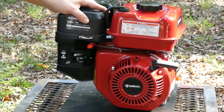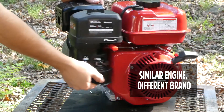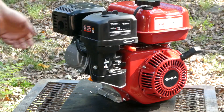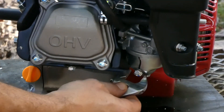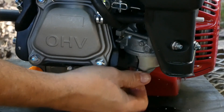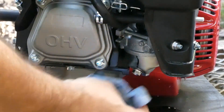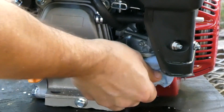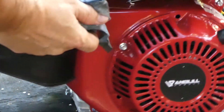Just for your information, I just did one of these that my father had bought a few weeks ago, and it was actually air-locked when we first got it. So just out of experience with that one, I'm going to take the bowl drain off and make sure there is fuel going through it before I start pulling on it. This is your bowl drain right here. There is gas in there — that's what I wanted to know. Now if yours does not do that, an easy way to unlock the air lock is to take the gas cap off and blow in there lightly with compressed air, or you can do it with a good blow from your lungs.